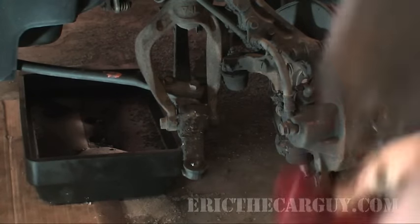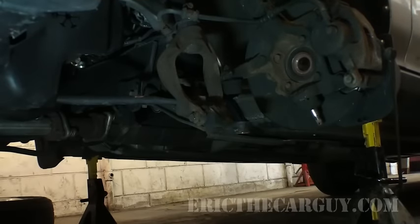There's a fair amount of grease here so I'm just going to clean it up. I especially like to get it off the brake lines because the grease will eventually eat away at the rubber. Now I did not do this part before, but I'm doing it now.